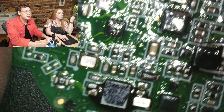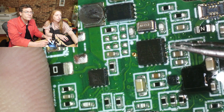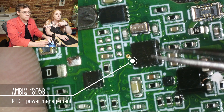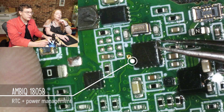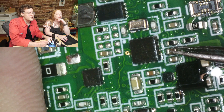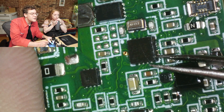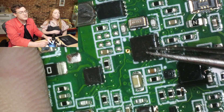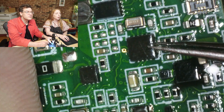The second chip I was able to find is the one that says 'ANBEAK' — that's a real-time clock and power management. When they say power management, they mean it's actually dealing with all the power-related features. It keeps track of the time and can also supervise turning on and off, doing soft resets and soft power on and off to the microcontroller.